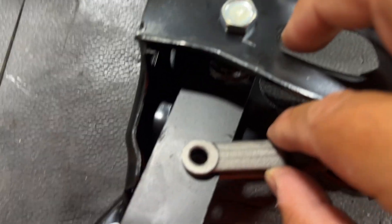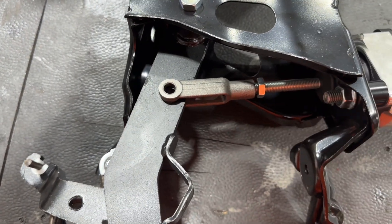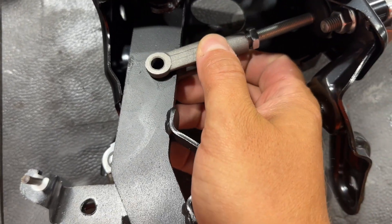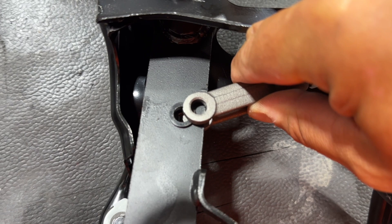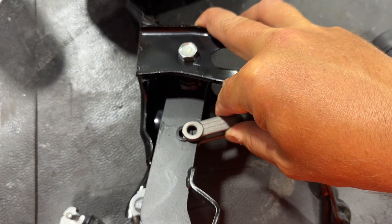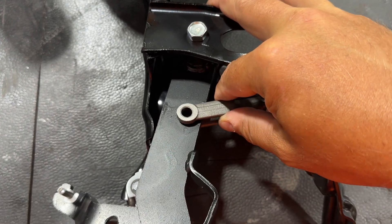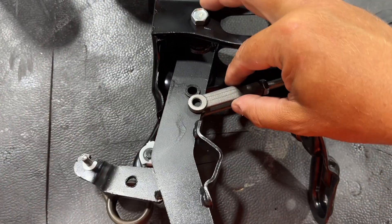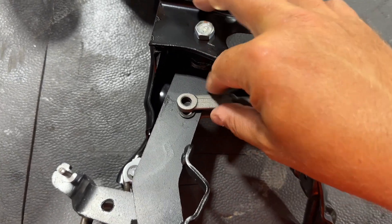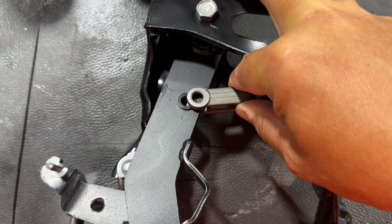So that when you go to install your pin, it's lined up. You don't want it to be pushed back because that's going to be adding additional pressure. You want it to be either lined up, or the master can be slightly this way so that when you pull the pin it can go forward — that's fine. Or the pedal can come backwards, because the pedal itself will just stop when it gets the master pulled all the way out. So either lined up straight with some free play, or slightly this way is fine as well.